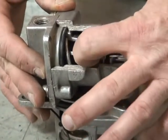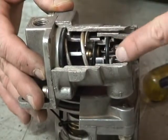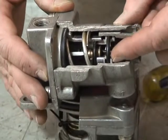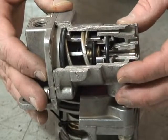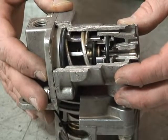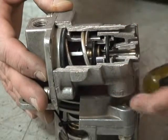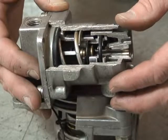When we get the equivalent air pressure by half on the bottom side of the piston area — because of the double surface area — it closes, or goes into a state of balance. This valve was designed to help prevent rear wheel lock-up when you were lightly loaded, as in the case of bobtailing with a tractor and no trailer on.